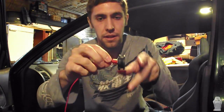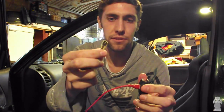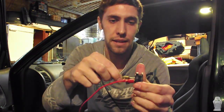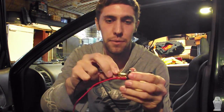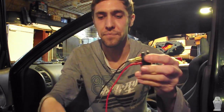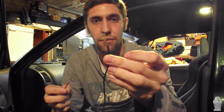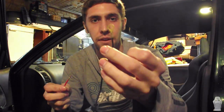We've also got this negative wire that we're going to use. We've also crimped a connector on this previously, and that one's going to go on the negative in the same way. This one's got a different type of insulation, but it's still insulated. And for the ends of these, on the power wire, the positive wire, you're going to need a loose end with just bare cable, and on the earth wire you're going to want a ring terminal for the earth.